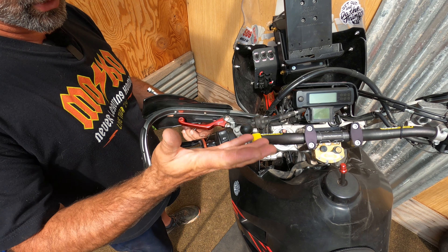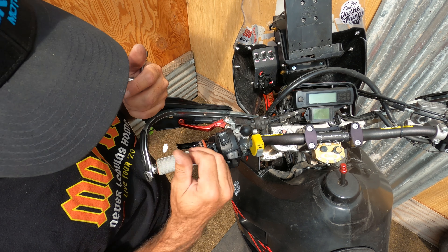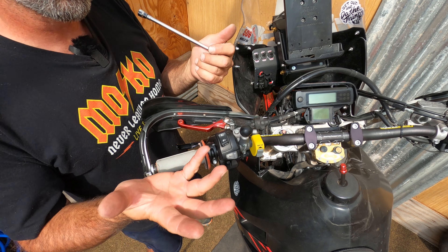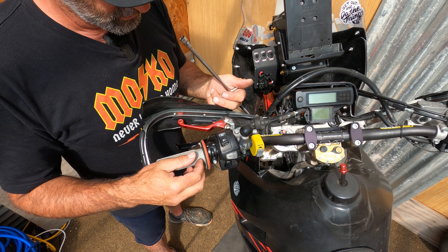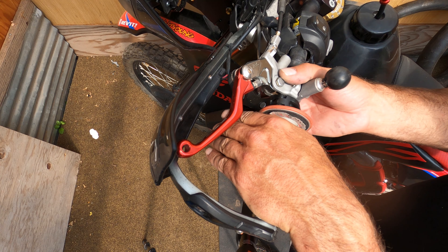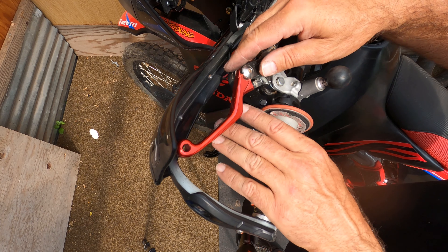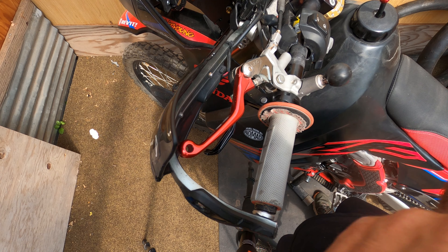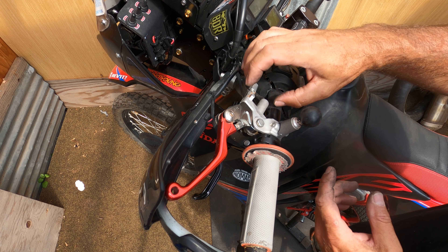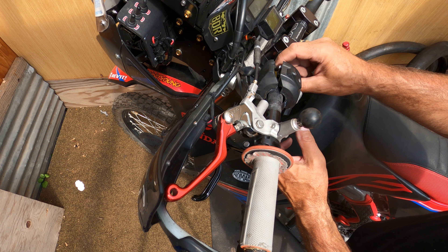This looks fine and actually works on any other bike that doesn't have all your controls on it, or if you take the controls off and move them inboard. On the CRF450L being a dual sport, there are switches on both halves of the control cluster, so I can't just take the back half off. To leave the brake lever out here I'd have to do some slicing and dicing to fit the fat part of the tapered bars.